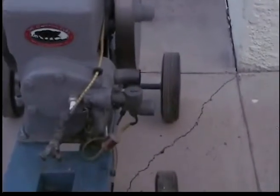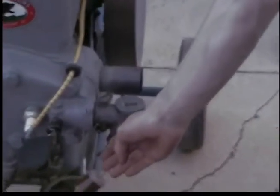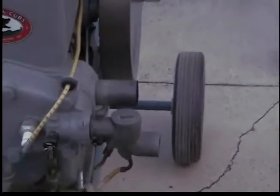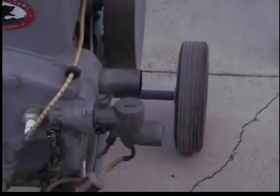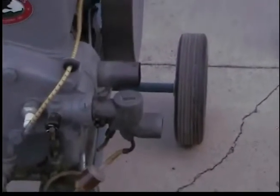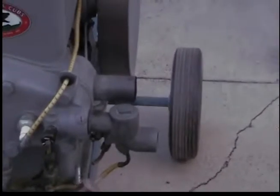This is pretty solid. It did need warmed up on a little bit of gas though. Just a little bit. It actually, see now I made it even richer and it's running better. I heard it cough and I can tell when it coughs and it sounds like that, it's too lean. You can actually tell. So that SeaFoam is so thick, you actually got to open up that valve at this point about twice as much as usual to get it to run happy. When you have gasoline there, you need it about half of what it is now.